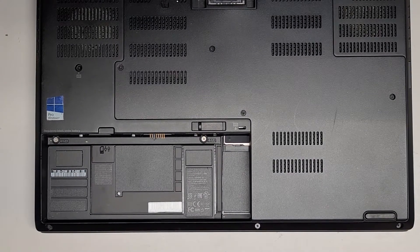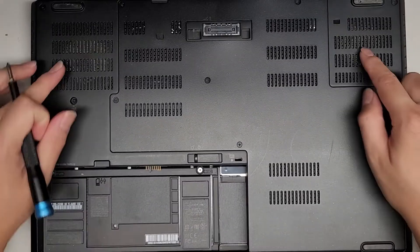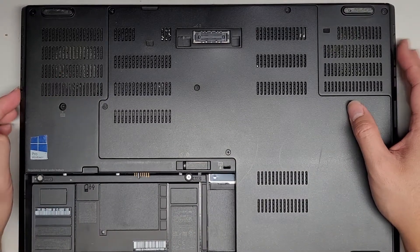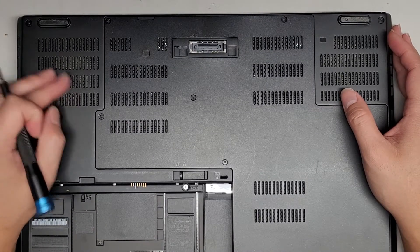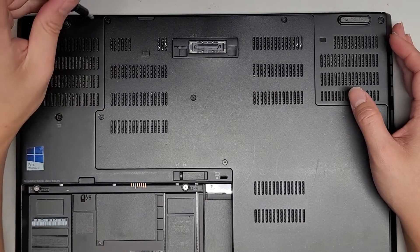This one we're going to be upgrading to a PCIe NVMe SSD. You can see the fans are kind of gross here, so I am going to see if I can clean that up without completely taking it apart — I'm going to brush this and blow air into it. It also helps to use a needle or something to hold the fan blades still, so big chunks of dirt don't get stuck in and damage it.